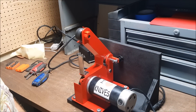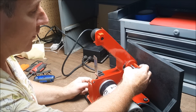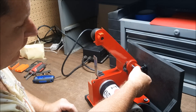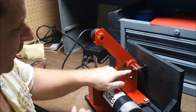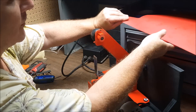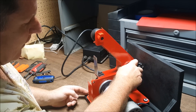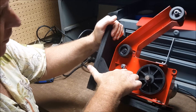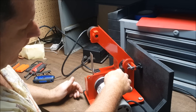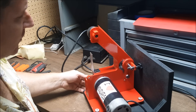One day later, the end results are a beautiful shiny red machine. I took the time to polish and clean all the parts and components — it works very smoothly now, maybe a little too smoothly. The one area I'm still having vibration from is in here. I am going to pull it back apart and put a little shock absorber right behind the arm. I've got this cutting board material — it's very slippery, like Teflon — somebody suggested I do that. So there's a Teflon spacer back in there, a Teflon washer right in here — it's very sturdy and it seems to slide back and forth. I also polished this back plate, though I don't think that was necessary with the cutting board material.